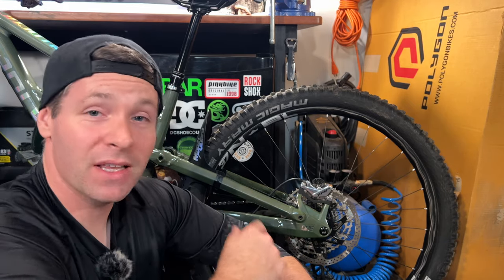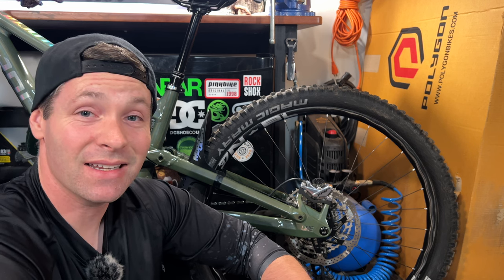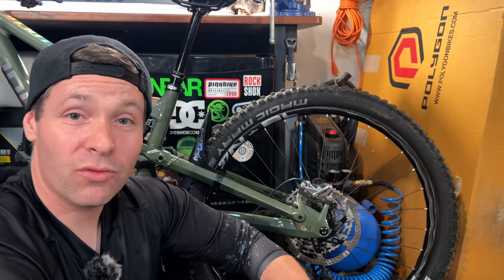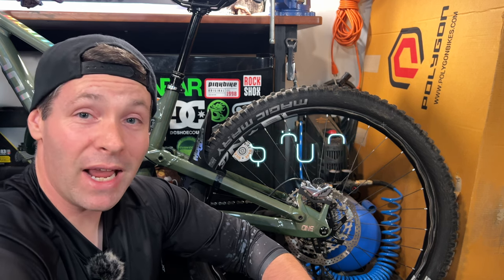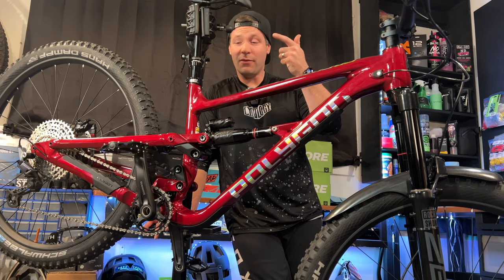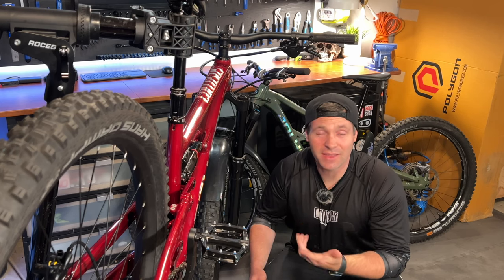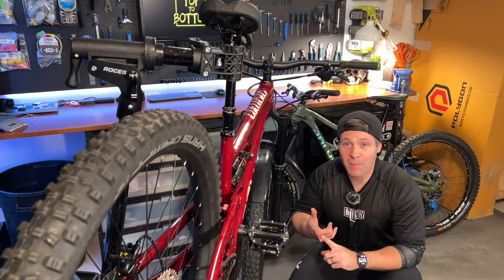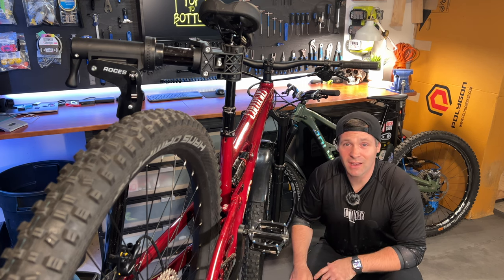These are the best feeling brakes I've ever had, but they're $279 a set. Add 75 bucks for each rotor and 50 bucks a pair for the graphene pads. That's over $800 for this brake setup. That's almost my whole budget I have for all the upgrades I want to do to this bike. The main issue I have with these brakes is that they just don't lock up. They're properly bedded in, they're definitely not contaminated, but they just don't grab like I like them to.